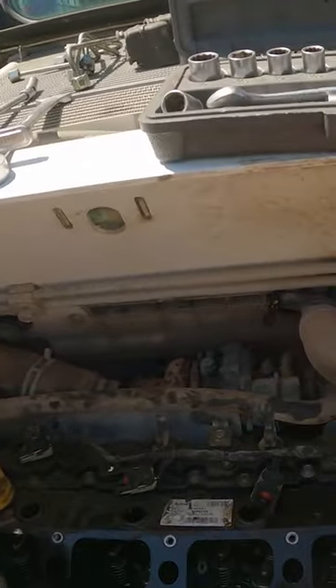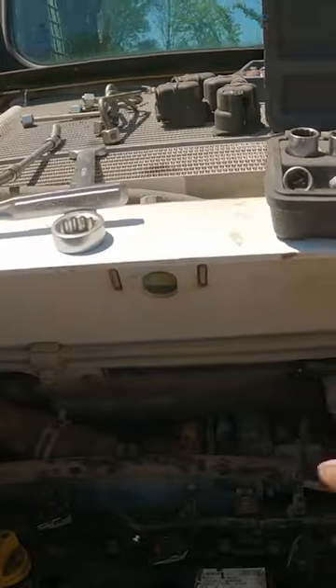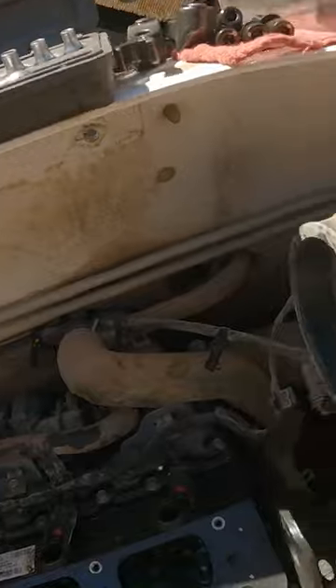Your clamps, both into your air box, and do your air box — two bolts back here. There's two bolts and a nut here, and then there's two bolts over here.